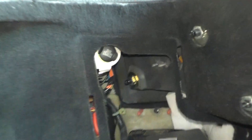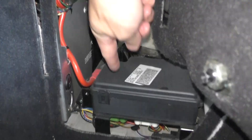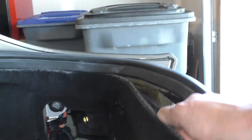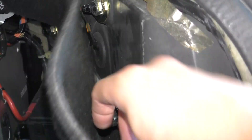In the trunk we've got three bolts on each of the taillights. The three on the left-hand side — that's the driver's side in the US — are all out in the open and each has a cap that just twists off by hand. The passenger side is different: you can only see two of them. The third is behind this cubby — there's a leather tab you can pull to expose it. There are a few other things to know about in this cubby: the fuse box, including infamous fuse 22; a battery disconnect switch on some cars; and a power outlet that's a popular charging point. Once you've removed the three caps, you can pull the carpet lining back to expose each bolt. You'll see there's a large washer and also a foam gasket behind it.